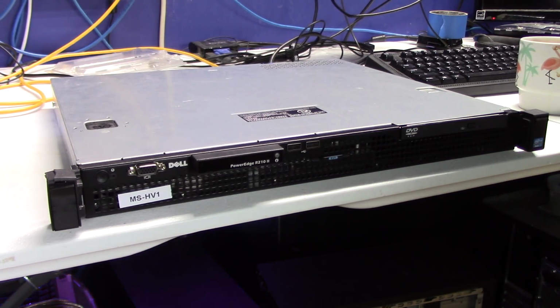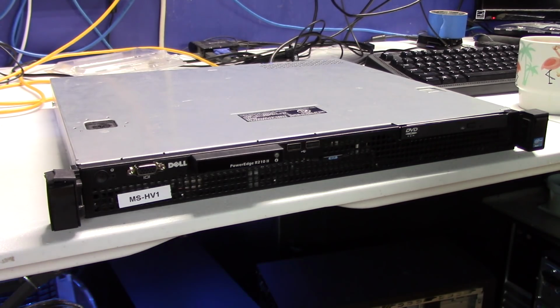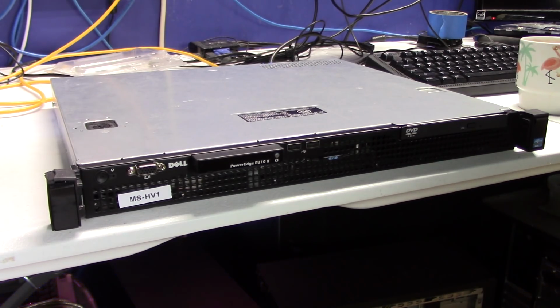And it's going to run Server 2019 with Hyper-V running. And the plan was to put my domain controller on here, the surveillance software on here, and then any virtual machines that I needed to run my day-to-day activity for the business in a sleek, slim, efficient, power-saving server. Suffice it to say, what I did was I kept one of the 500 gig spinning drives in this unit and then moved the 1 terabyte SSD drive over. And then installed the operating system, installed the surveillance software, and installed the virtual machines on here, like my phone system, and then a couple of Windows 10 virtual machines that I make available to outside users.